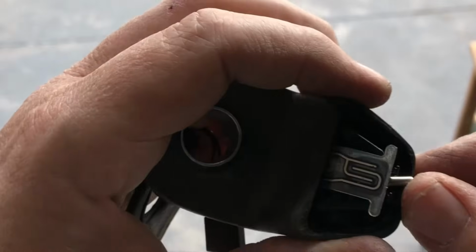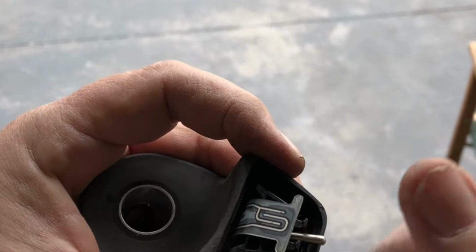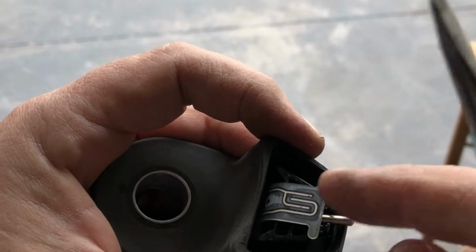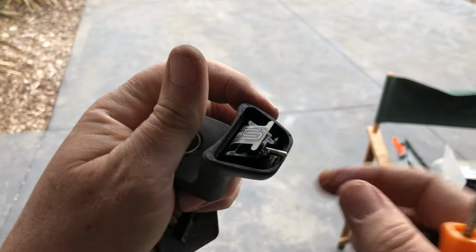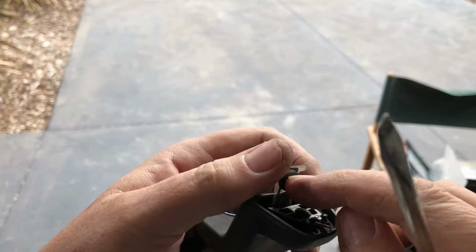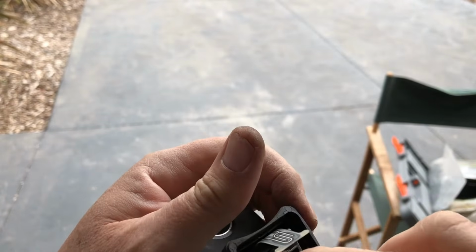And then of course with a switch, a circuit switch like this, you'll see you've got the connection here and the connection here, and when there's contact, it joins them, which opens the tailgate, and when there's not, it doesn't. So of course any moisture and shorting in here, anything going on is going to muck it up as well. Just basically pressing that up is what contacts the switch and opens it up. So it could be that this here is cactus.